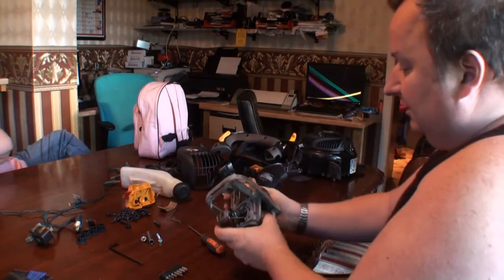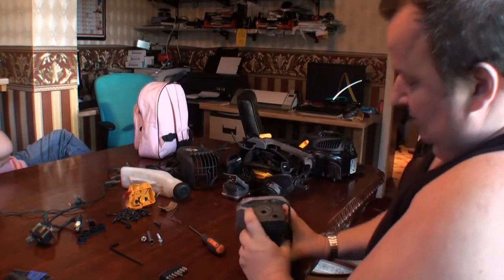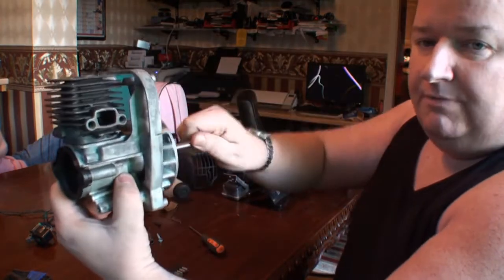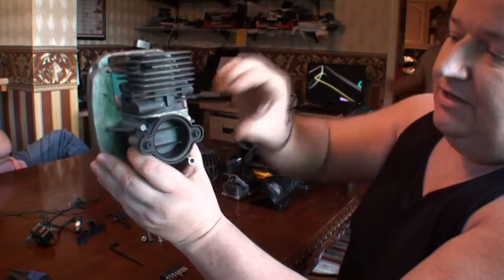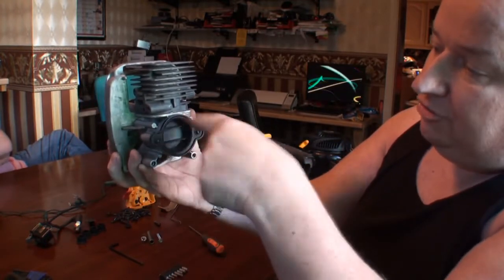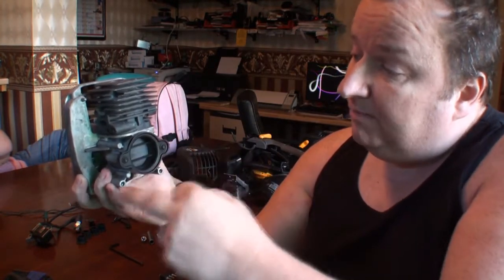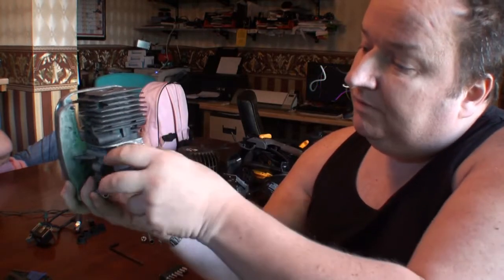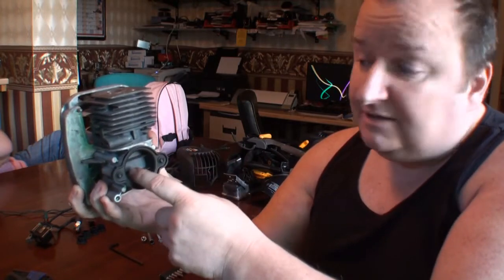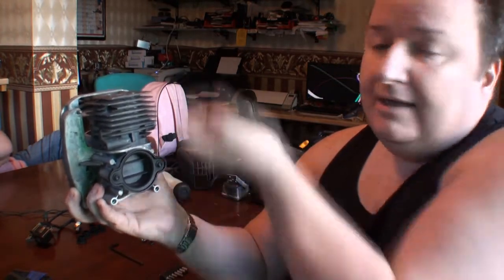The simple reason being, on this McCulloch, this is the actual cylinder. This is the rotary bit where it turns the big fan over, and this is obviously the crank case. If you undo those two screws there and pull that cover off, you can actually see the crank. In a two-stroke, like a two-stroke motorcycle engine, this works exactly the same — the fuel goes into the crank case and then it compresses and goes up the transfer ports into the barrel and then gets compressed.